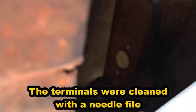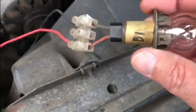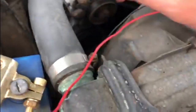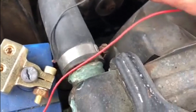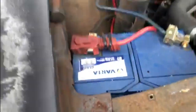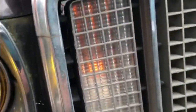After cleaning the terminals on the socket — the socket plugs in back there and just goes in and twists — I got it working. What I did was clean the terminals, then got an ordinary bulb in an old socket through a bit of chocolate block and pushed that into the live side of the terminals and the earth side. Turned the side lights on, and the bulb lit up. So when I put the old bulb back into the socket with the clean circuits it was working. I plugged it back into the car and as you can see it's all lit up, and I've also got the side lights showing in the radiator grille. A nice easy fix — it was just dirty terminals not getting a good earth. Once they were cleaned up and everything was plugged back in together, everything started working again.